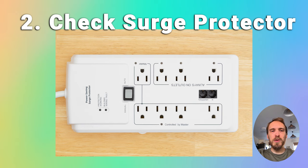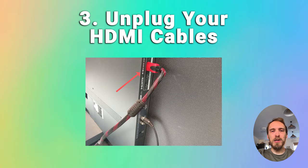You also want to make sure there are no HDMI or external connection problems. Try taking out all of your HDMI cables and all other cables from the back of your TV other than the power cable, then try switching it on and see if you're still seeing the black screen or the sound with no picture problem. If you're still seeing the problem, you know it's not an HDMI issue.